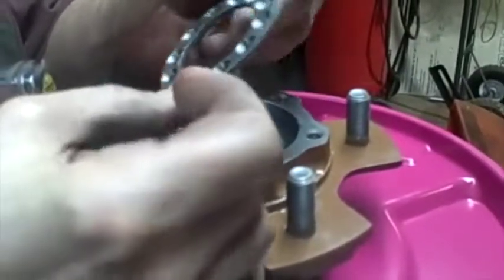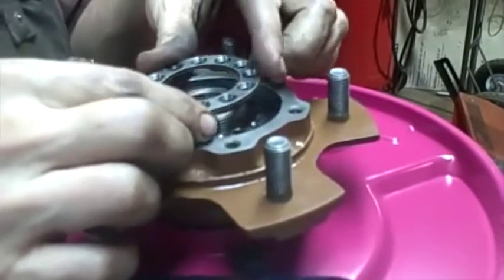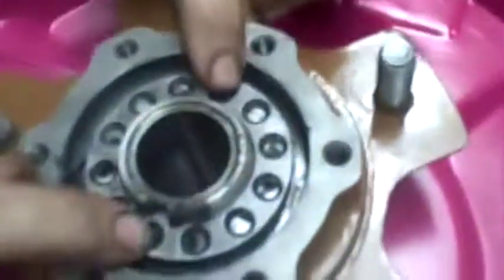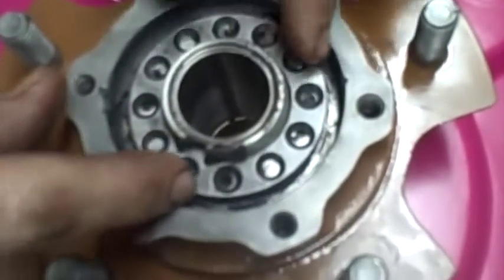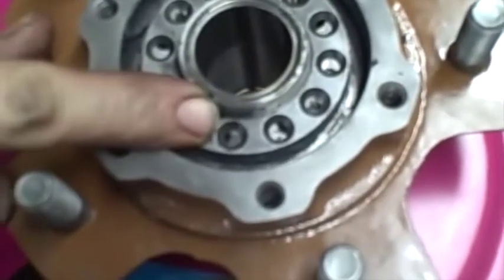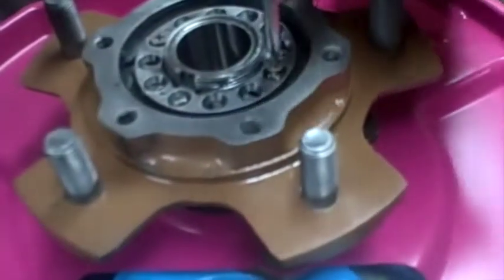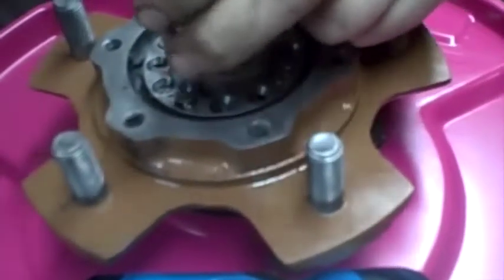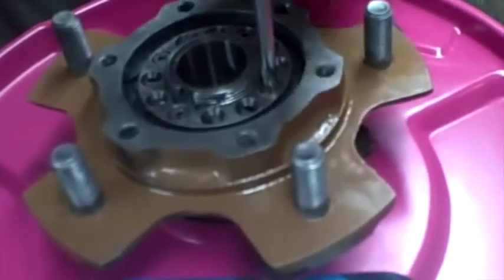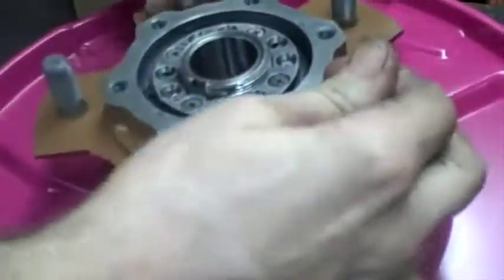Now I'm going to put this ring on - it has a little groove that slides into that groove on the spindle, and the side with the dips goes up here. I need to see if my screw holes will line up. Looking right down on there you can see the screw holes are not lined up - I'm going to have to tighten it a little bit more. I torqued it to 147 and I think my screw holes are lining up - one, two, three, four. All the screws went in; just going to snug this down, not too super tight but tight.